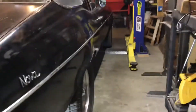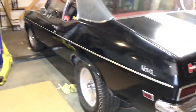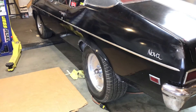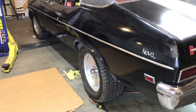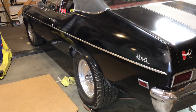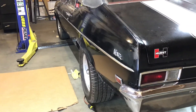It's raised just a little bit — I've got a 275/60-15 on the back. My slicks are 28×9-15 on a 5-inch backspace custom Corvette rally wheel, so they work really good. Anyway, that's the video update — sorry I didn't get to actually videotape it as we were going, but you get the gist of it. Those parts are cheap, good, and they'll last. All the suspension — the tubular A-arms, the disc brakes, everything I've put on has been easy to install with no major issues. Don't be afraid to convert things over and make them better, because you just ain't going to get there unless you put the effort in.